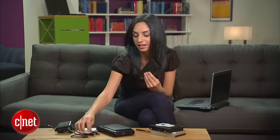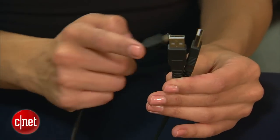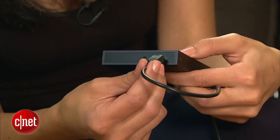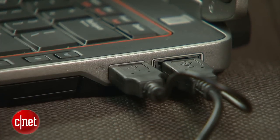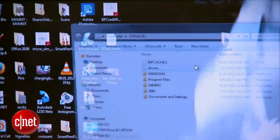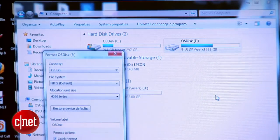This enclosure came with this cord — it has mini USB on one side and two USB connectors on the other. The reason being that this drive needs more power than normal USB devices. So I'll put my mini USB in here, connect both of these USB cords to my laptop, and there it is. My computer recognized it just like it would any other drive. So now I can open it up, browse some really old files on here, or I can reformat it and start with a clean slate.